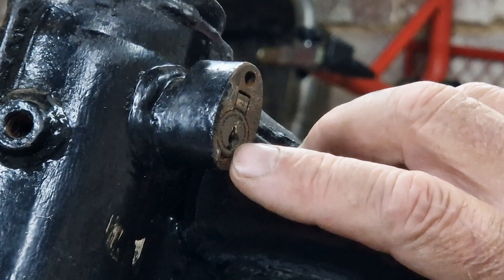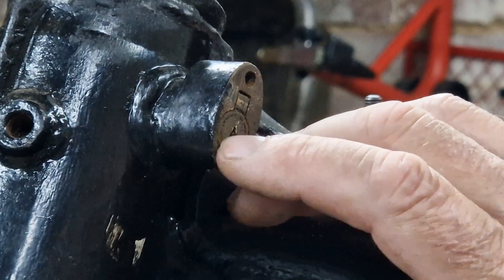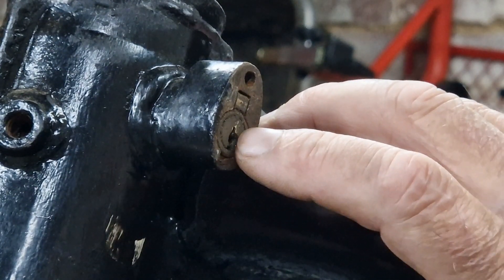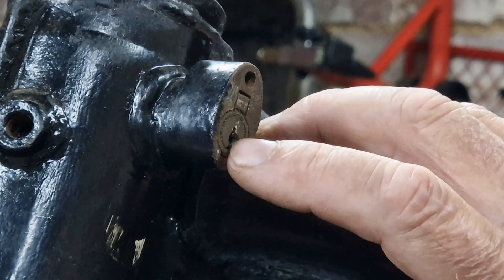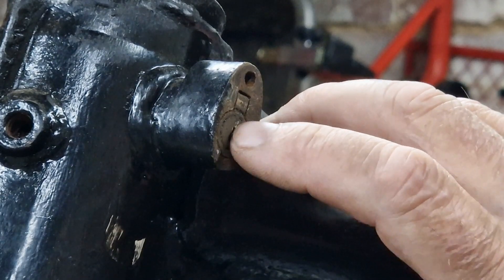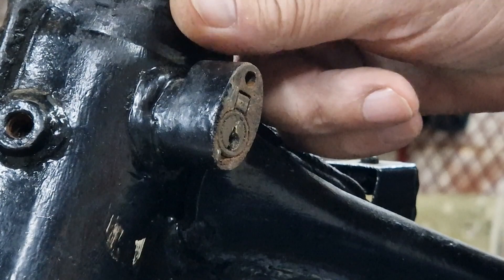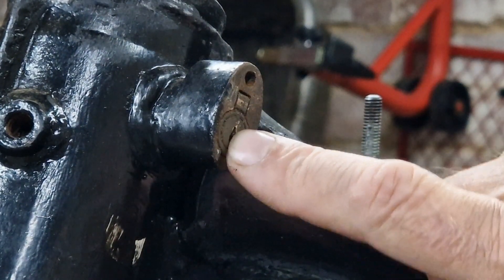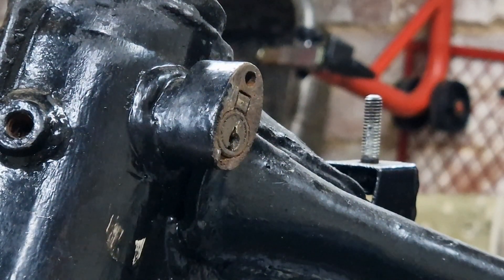What I need to get out is the lock itself in there. What I think people do now is they either try to drill a hole where they know the pin is to drill through it. I don't know where the pin is on this, but somebody on a forum suggested the way to do it was to get a punch, punch it through into that way to break the pin, and then screw a self-tapper into the hole and pull it out that way.